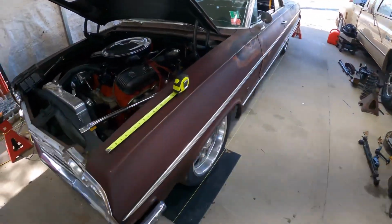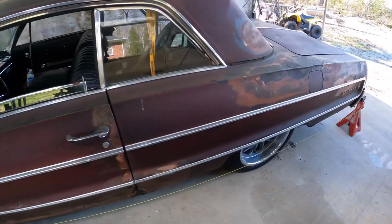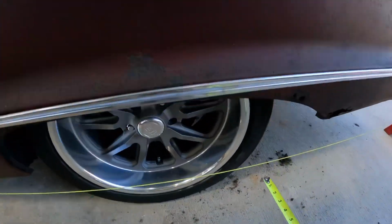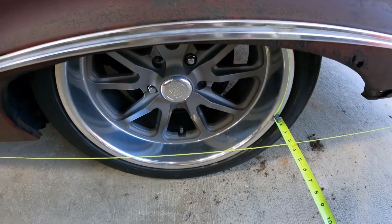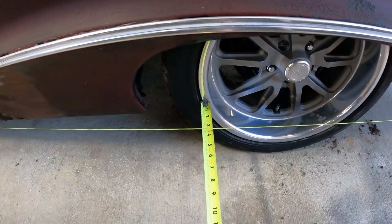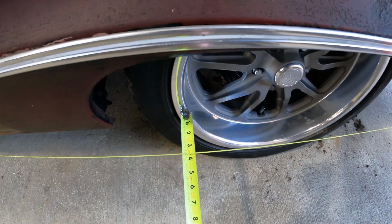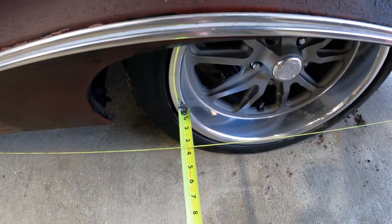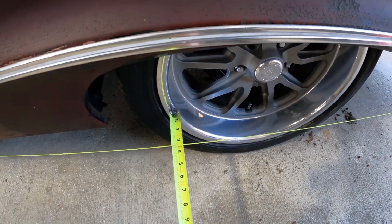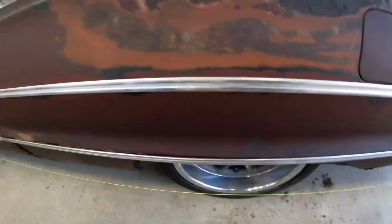But basically all you're doing now, like I said, this ain't exactly a Hunter alignment. You'll square the string off the back wheel evenly, right? So unless I've kicked this thing by accident, which happens, that is roughly, looks like 3 5/8, both sides, pretty close.